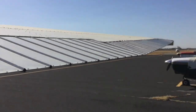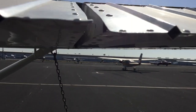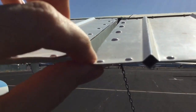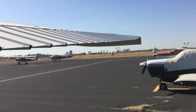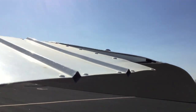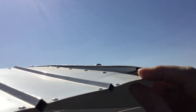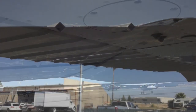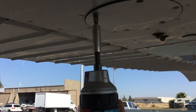Checking the right aileron to make sure it is lined up with the flaps — and it's actually lowered a little bit there. There's also a small ding in that flap that would probably need work. Checking the outboard edge, you can see it's lowered a little bit. I can basically stick my fingertip in there, so it's down in the slipstream. We're going to pull off the inspection covers, gain access to the turnbuckles, and get up in there and fix that.